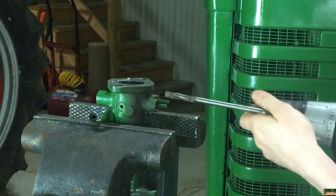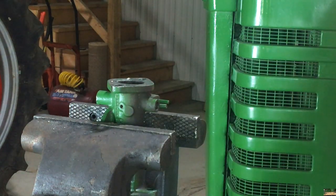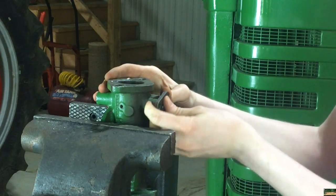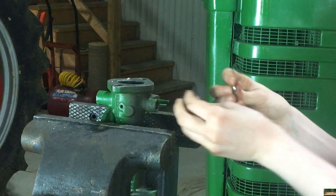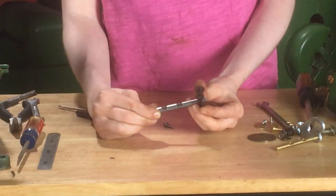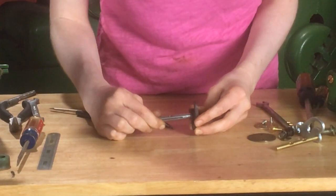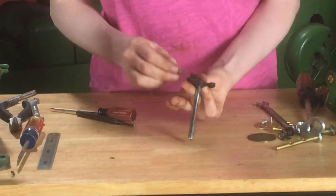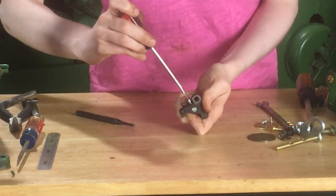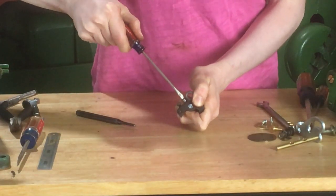Both of my new bushings are in — I pressed them in until they were just flush. Now I'm going to drill through with a reamer here to make sure that the new throttle linkage will seat in there properly. I'm ready to insert my new throttle linkage and I'll slide it through both sides. Make sure that it fits properly — there shouldn't be any improper play and it moves correctly. Next, we'll put the felt on this end and a soft plug on the other side. The throttle linkage is directional — the flat side goes towards the U in the assembly, and the smooth or rounded side goes towards the back. Slide it so your hole lines up and put your screw through on this side and tighten up.